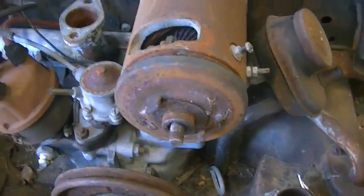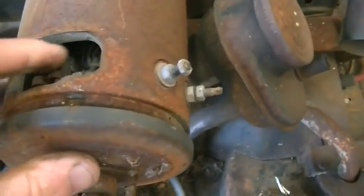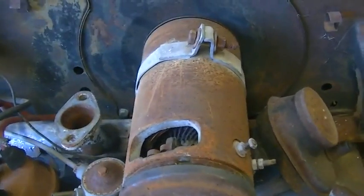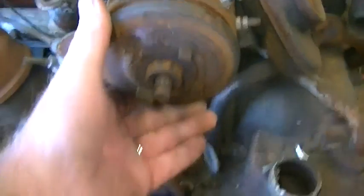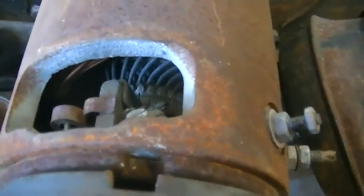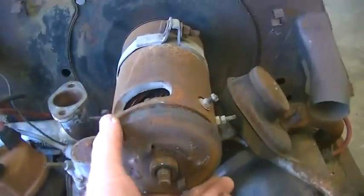So we've taken the belt off and the first thing we notice is that the bearing is shagged and the rotor is actually sitting on the armature. So that's project A shelved — I'm not going to do much with that until such time as we put some new bearings in it. And hopefully it hasn't worn out the stator windings and the rotor itself.